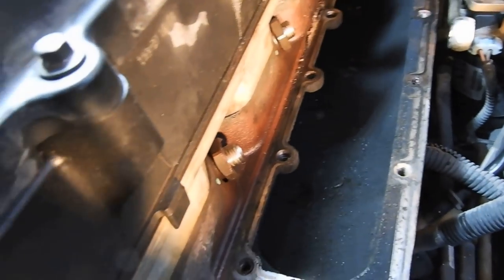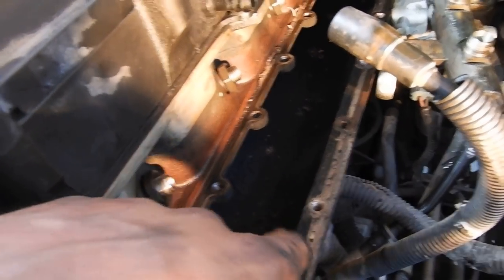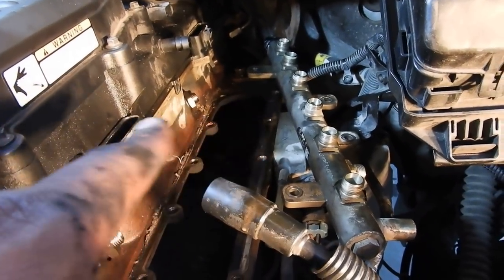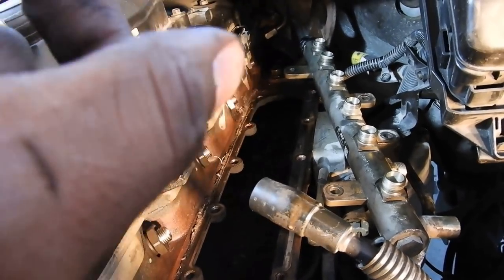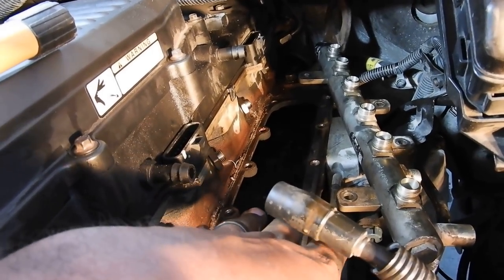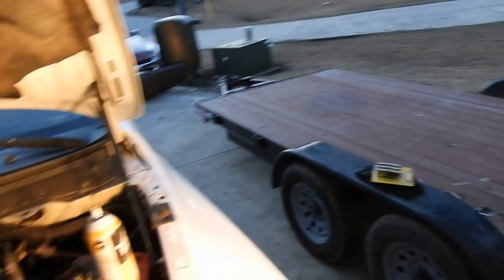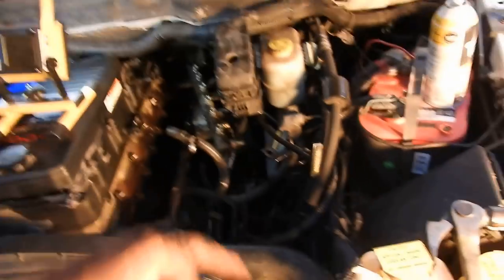I got it out. Real quick, this is what it looks like - a lot of that is just soot, we can't really do much about that. Next we're going to clean up the surface - get that all cleaned with some brake cleaner. Make sure you clean this up. Also, if you're doing this, make sure you don't get any dirt in your fuel rail or lines. What you really want to do is cap or cover everything up. When you take the injector lines off, put them in a Ziploc bag and label them.